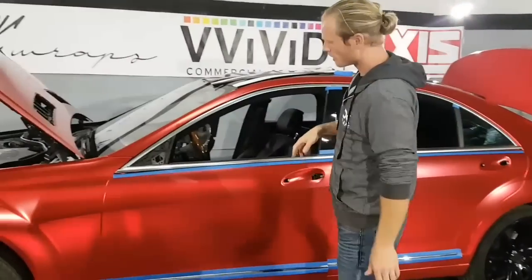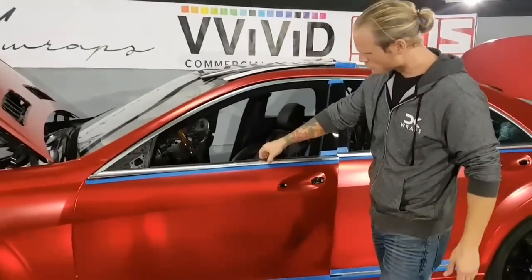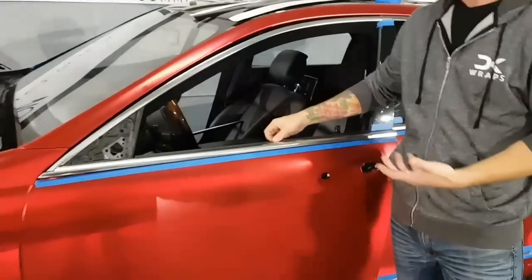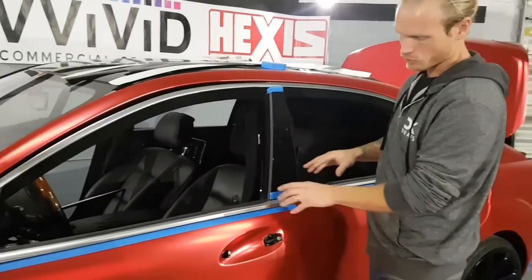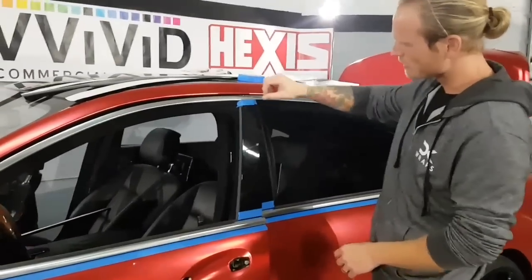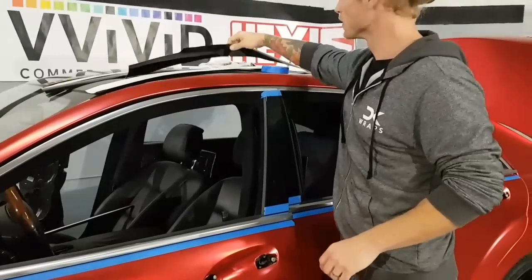What I'm going to show you today is this piece, this piece, and the bottom piece — they're all fairly straightforward. This piece is actually pre-loosened so it's going to pop off really easily. That way we can tuck in behind this seal really nicely. What this comes down to is how precise your cutting is. I've gone to greater lengths to mask off surrounding areas so we can cut on this piece and tuck the vinyl in very slightly, because this rubber piece will lift up, giving us full coverage across all the chrome.